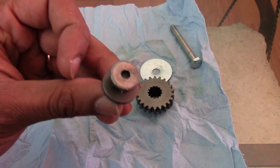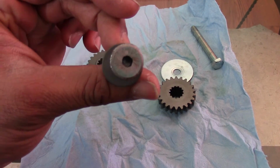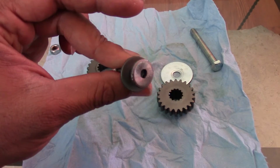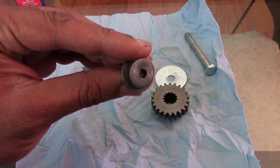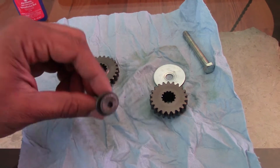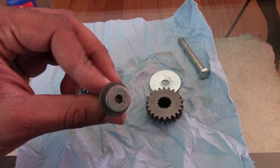It's simply, if you look here, it backs out into the back of the clutch, and the clutch grinds it down. Now, you'll know that you have a problem because you may hear the screeching metal. It sounds just like a high-pitched chirp like the supercharger, but it's actually the screeching metal of the clutch rubbing on the nut. The bolt here. And you may not be able to downshift or put it back into first gear. That'll be your first indication you have a problem.